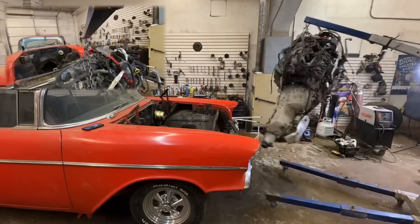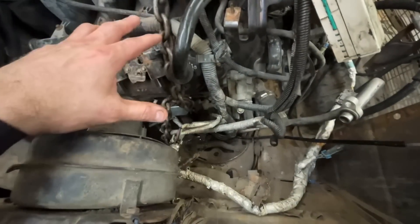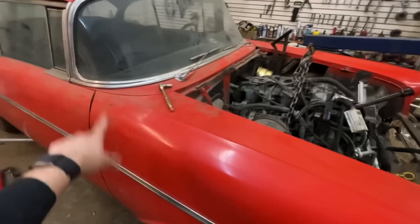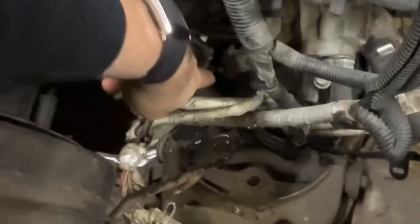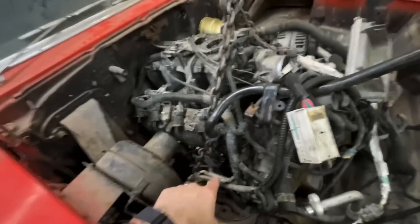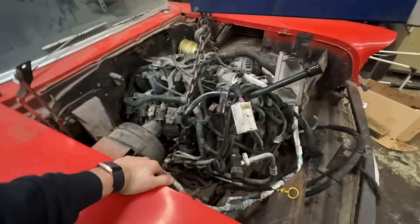She is in there sitting pretty! This has been a very productive day — granted I've been here 10 hours. I still have to finish up the mount because I ran out of time today, but they're basically ready to go. I also changed the position of my chain — right now I have it held up by the jack and by the hoist so I can get it exactly where I want it side to side. Tomorrow I'll come in and get those mounts fully welded, do the same in the back, and then I want to test fit my headers — it gets really tight over there with the steering. But it is late and I am tired, so we'll be back tomorrow.